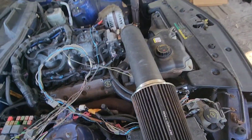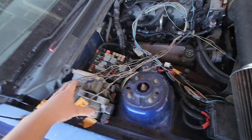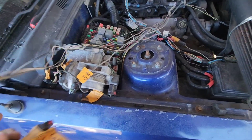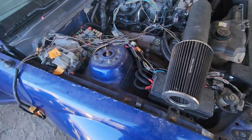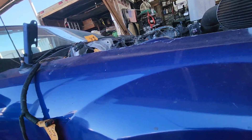I'm going to be going through cleaning up all the Ford wiring, making it look nice and neat like it was supposed to be there — cleaning up all this stuff, all these loose ends, all these plugs for the air conditioner and stuff like that. We're just going to tie them away for now until I get to hooking that all up. But what I'm doing right now is running a couple wires from the front of the car to the back of the car for the fuel pump relay.